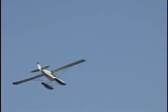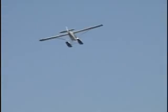She's running smooth. The maximum cylinder head temperature is about 310 degrees. It's smoother and smoother. In fact, 2,500 to 2,600 RPM — just really silky smooth.